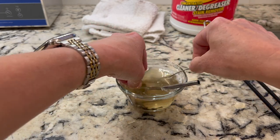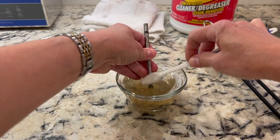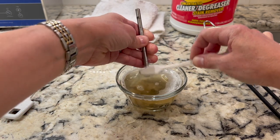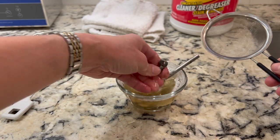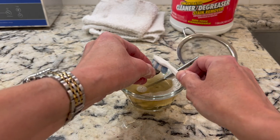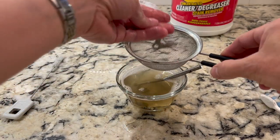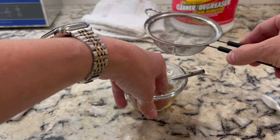Keep scrubbing until you've gotten all of the varnished oil and residue out before you rinse. Looking at the needle bar, I decided it should go into the ultrasonic cleaner — you'd want to scrub inside where the needle bar clamp goes on the machine because a lot of lint and oil collects there and gets really gunky over time. Once you're happy with how clean the parts are, use a strainer so you can rinse off all the chemicals and end up with a clean part.